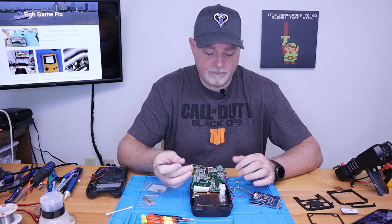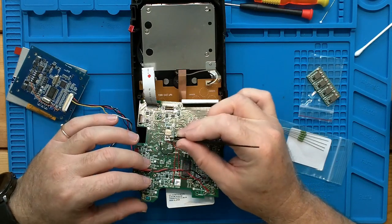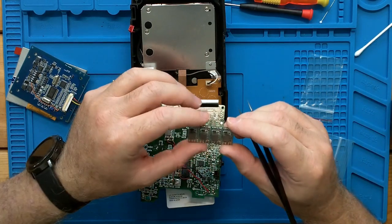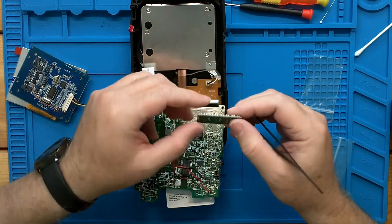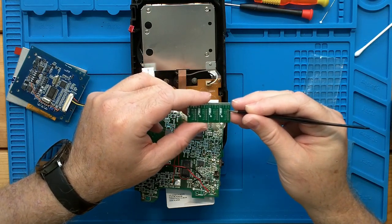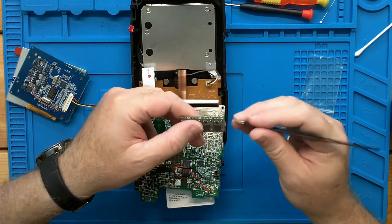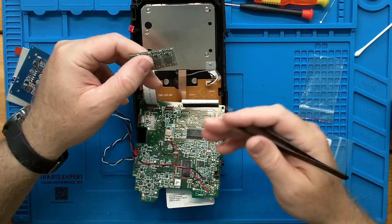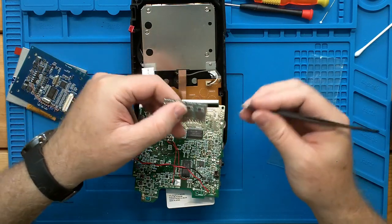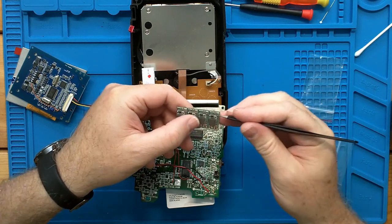So where we stand, we installed a 5-volt regulator, a totally standalone part. These can be had off Amazon, actually, and they're fairly inexpensive, only about $10 for a pack of 5. They can be set to a specific voltage, although I don't always recommend using the solder bridge because the voltage may be a tad high or a tad low depending on the application. Although this is a 5 volt system, we know from the factory they were usually set at about 4¾ volts. So they are adjustable with a pot, and that's my preferred method.